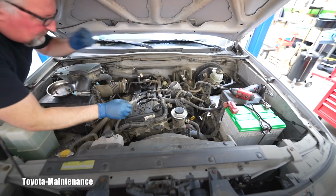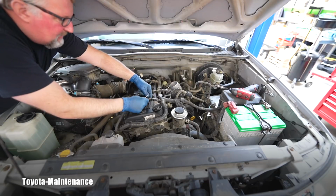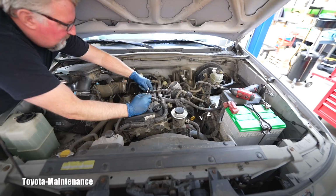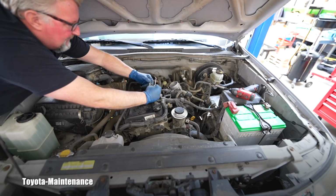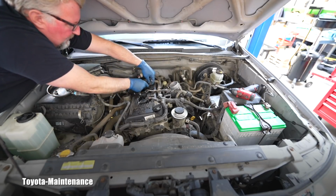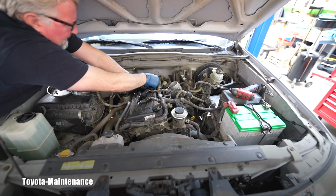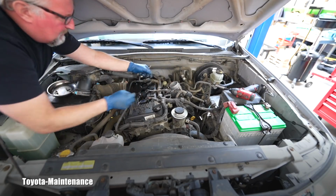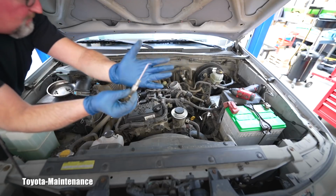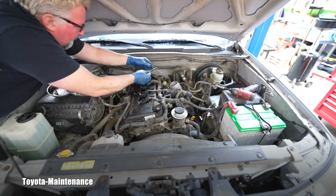These little electric connector tabs are sometimes finicky. Let's see if this one, if I squeeze it on the back, goes very easy. Let's see the other one. So they either fixed the problem, improved it, or redesigned it or something. These ones are going really easy. On some previous models, you will be pushing on the tab as hard as you could, and it will not work. So I normally help myself with that little pick to lift the tab and not break it.